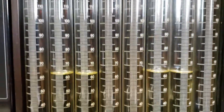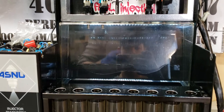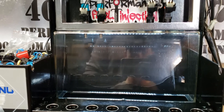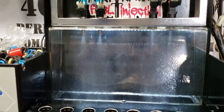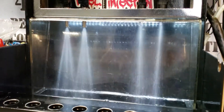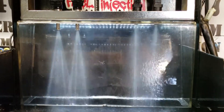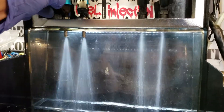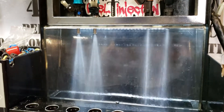I'm going to do one more test — a pulsed spray pattern test — because the one we did at the beginning of the video was a static spray pattern test and I know it's going to be a little bit different. We got them back up on the rack. You can really see the difference now in the medium cone versus the narrower spray pattern of the PFI 1000s. Similar spray pattern all the way around when rotated.